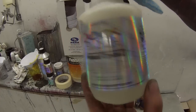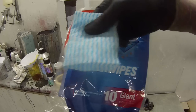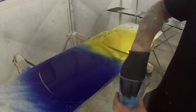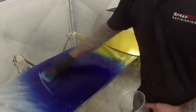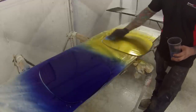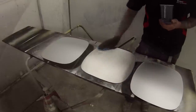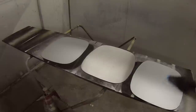As you can see I've done a few different ones. A couple of those blank panels I actually left in bare aluminium just to see how that would look. Moving on, we're going to get the crystals on. All you do is get those crystals — it's a liquid — put it straight into your mixing cup. You don't dilute it, you don't mix it with anything. Use chuck cloths as they don't really leave any lint behind. Make sure you get full coverage over the entire surface. If you miss a spot, whatever colour you put over the top — usually black — it'll just end up as a black spot, because these crystals act as little pieces of masking which you spray over and then remove, so you can see through to the underneath colour.